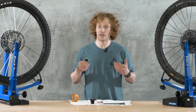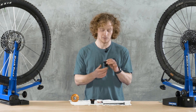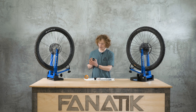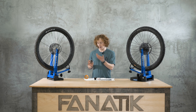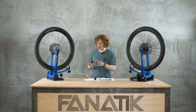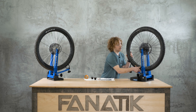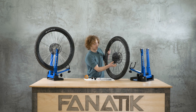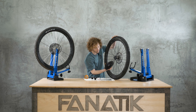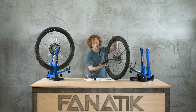So why is the new hub that much quieter? With way more engagement, my first thought was that it would be louder. But it turns out that because the pawls are actually smaller, there's less mass whacking them into the drive ring. Also, each tooth step is not quite as tall, so there's less time for each pawl to accelerate into the drive ring, and less distance for the spring to push on it — all of which makes for a slightly quieter design. Obviously it sounds pretty different overall, since you're working with almost six times as many engagements.